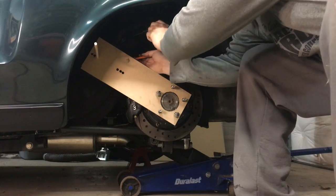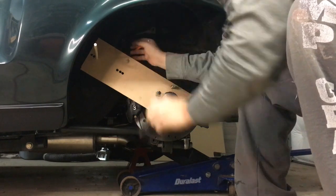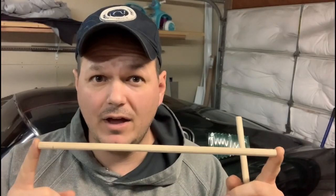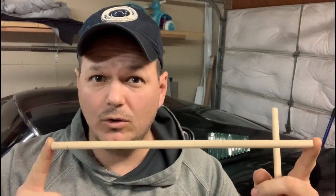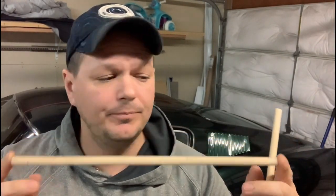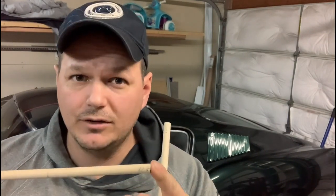Here I am marking the back face of the tool, as the back face of the tool also represents the back face of the wheel hub. Now that I have found that my 12 and a half inch dowel is the largest dowel that will fit in my wheel well, I know that 12 and a half inches is roughly 315 millimeters. So the fattest tire I can fit in my wheel well is 315 millimeters.